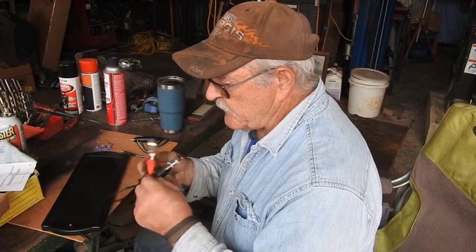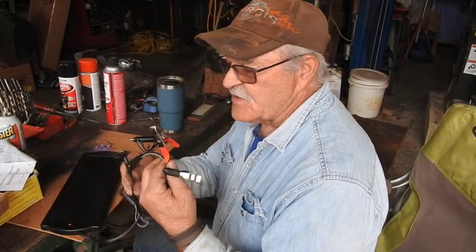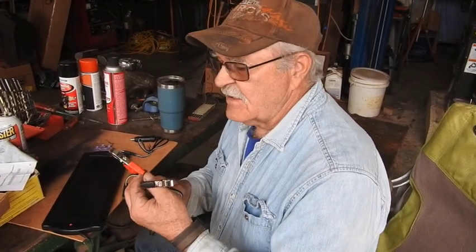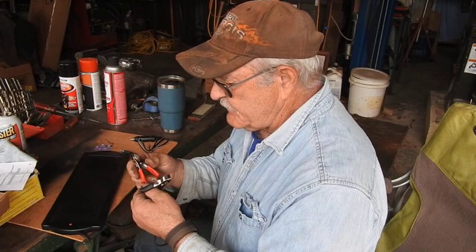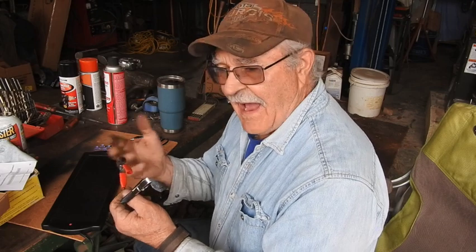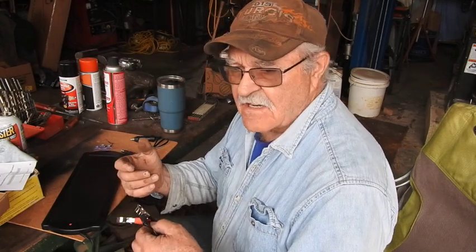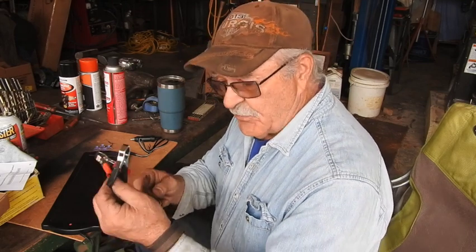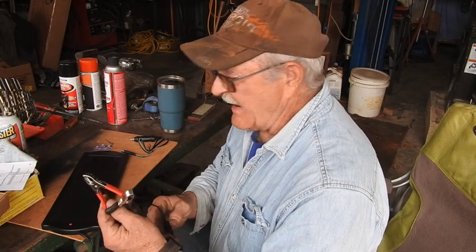In case you do go directly to the battery, you can do like this right here — it's got another option in the pack where you just put the alligator clips right on the battery, which is okay, but they're going to be subjected to corrosion and all that kind of stuff. You'd probably want to opt to cut these guys off and put eyelets on if you actually have a pedestal that has a 3/8 bolt thread or nut or studs sticking out. You can put that little fitting right on it, tighten the band down with the nut, and that'd probably be the best.